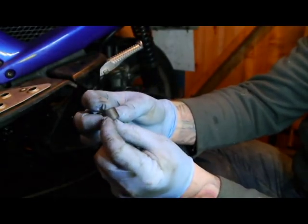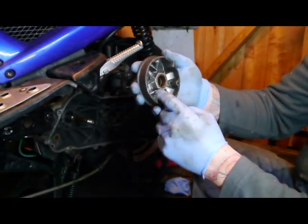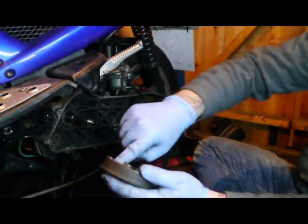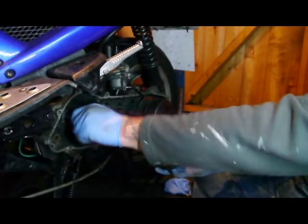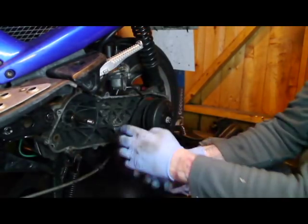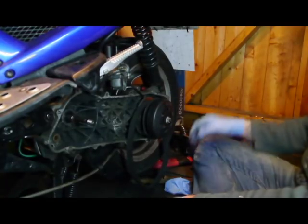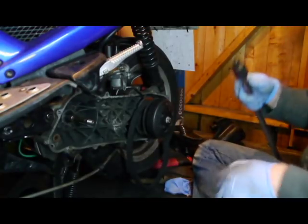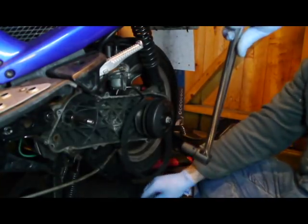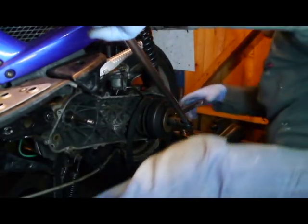They're sticking - flat spots on all of them. What's causing that? They're dirty. They're not rolling in there properly - this is dirty. There's actually oil on there. So all this needs cleaning. Let's get this off and have a look. This can be a bugger to hold in there - might need WD-40. Let's get some leverage on it.